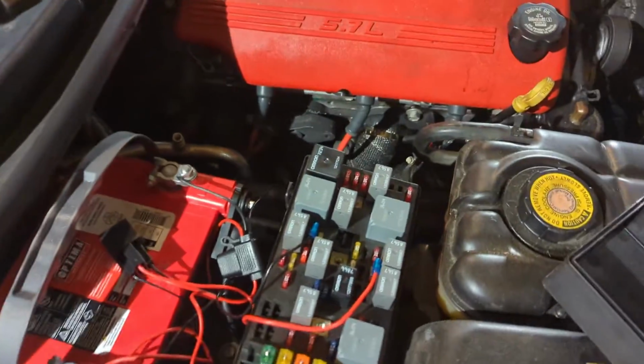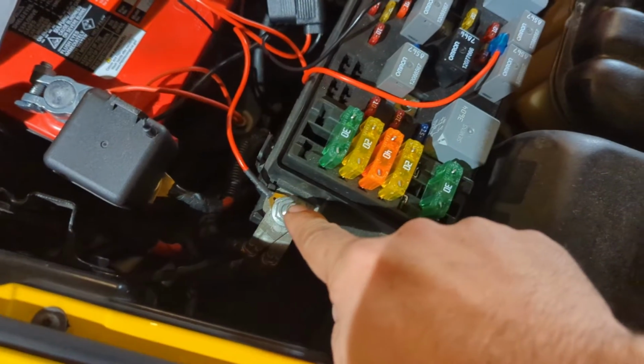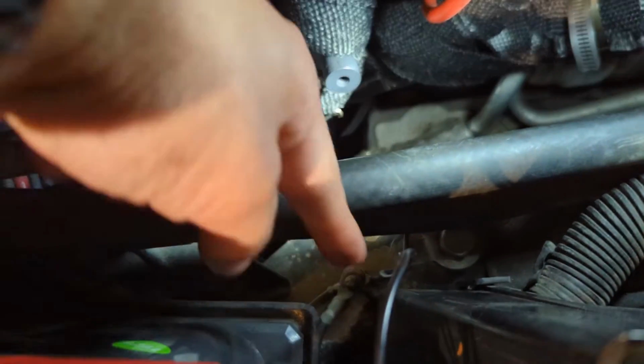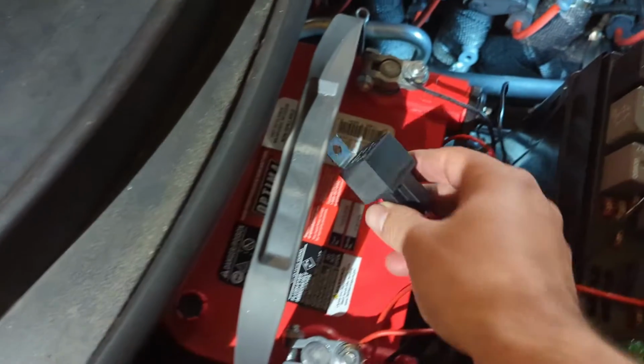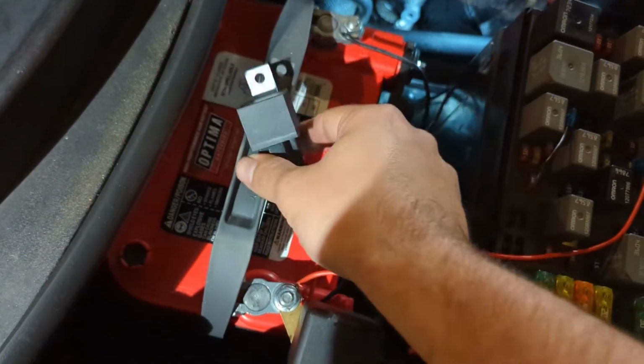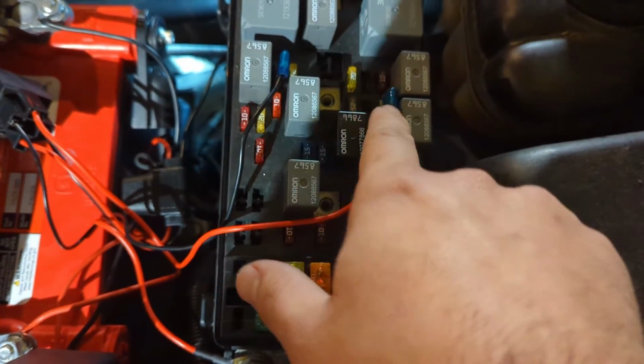This over here at the fuse box is super simple to do. You got your power going there, your hot rather, and then down there, my finger is right there, that's your grounds. And then you got your relay here, which doesn't really tell you where to put it. I guess I'll just zip tie it to this handle or something. It's kind of goofy, but and then these go to these two fuses right here.